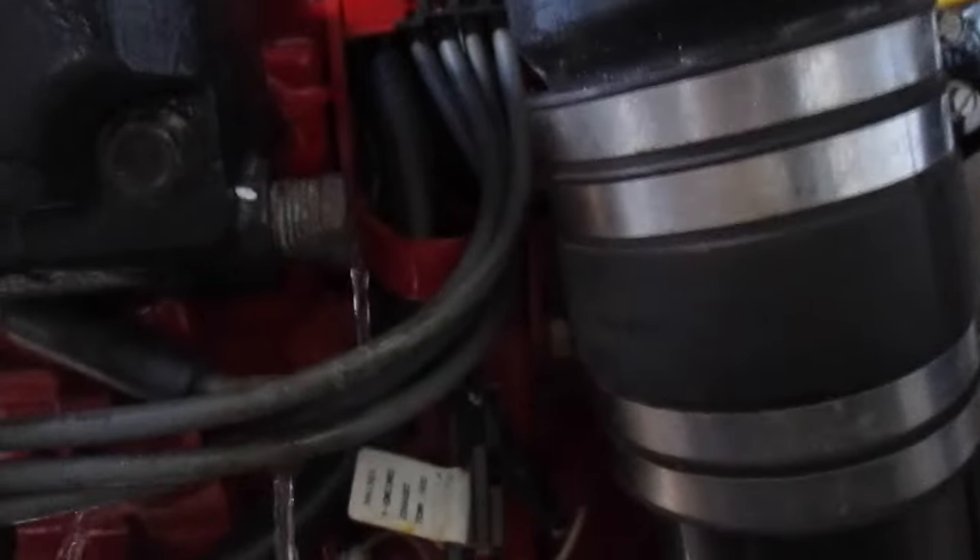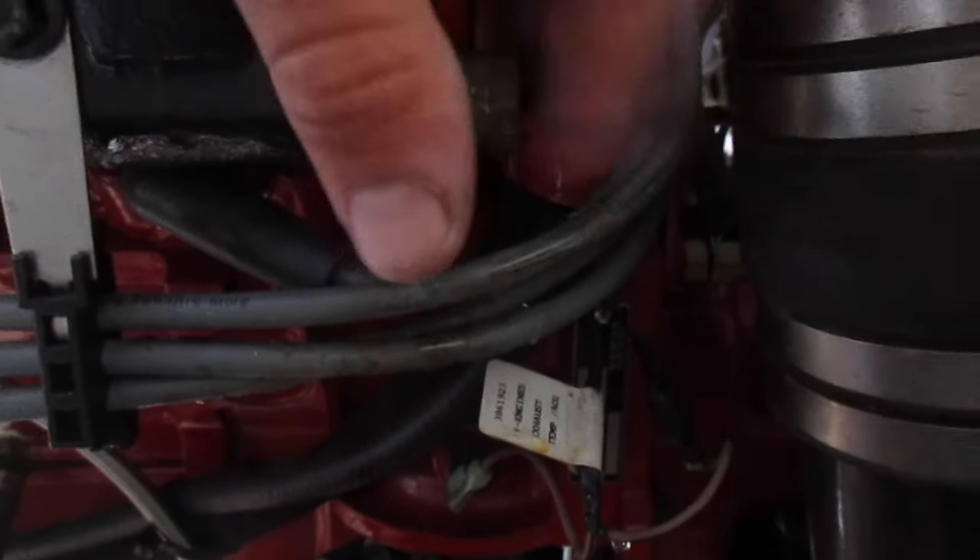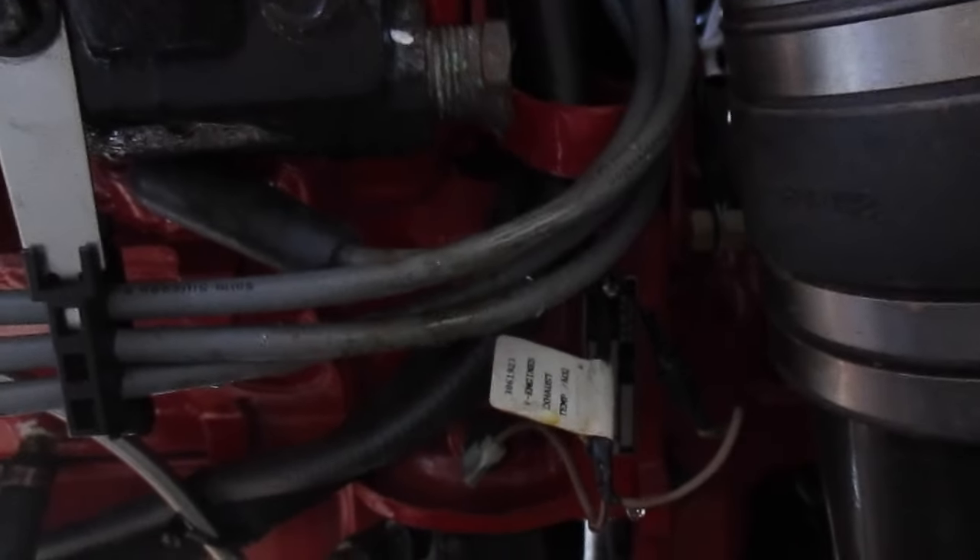Here's our plug — I've got it loosened. Undo that and you can see it's running. You want to make sure you poke it because you can't really use anything straight on this one since the manifolds do rust. I use a zip tie here — go in there and move that around to be sure that it drained.